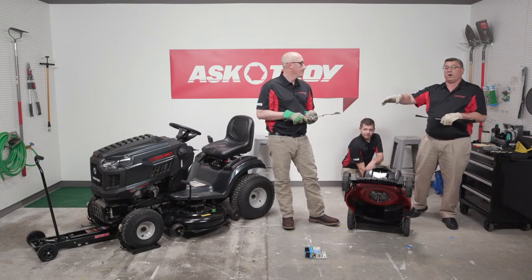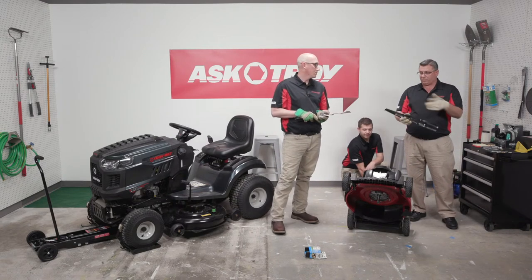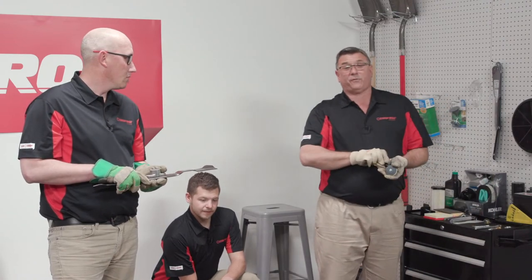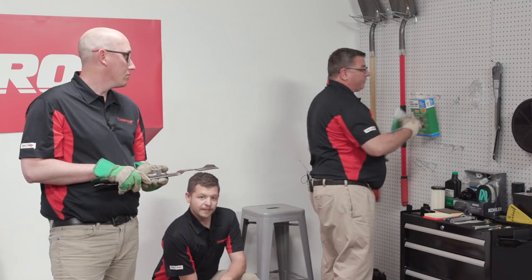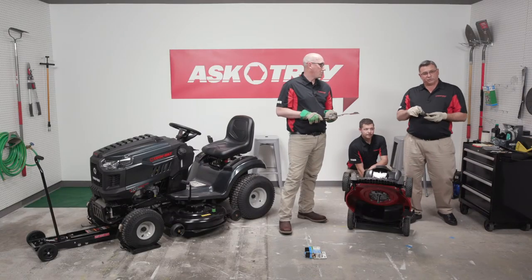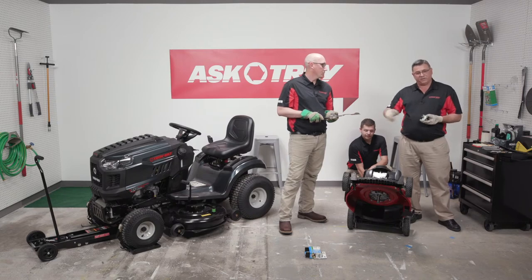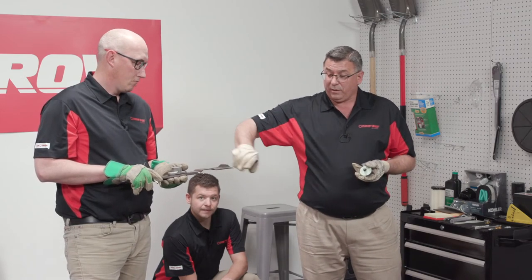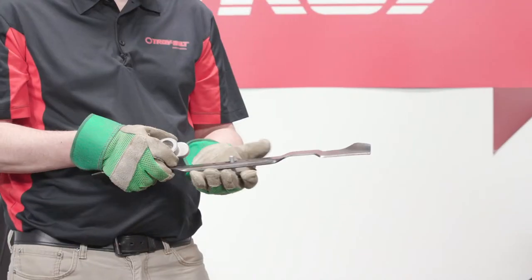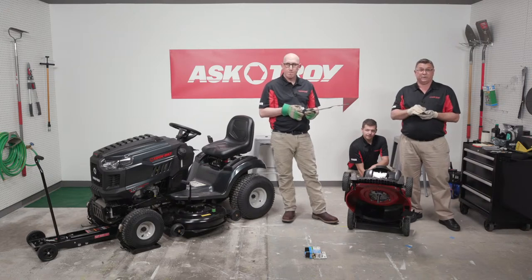You can imagine in your yard you might hit a stake or an anthill. Once the blade is off, you can either replace it or sharpen it. For sharpening, you use a hone kit — a hone that attaches to a drill. Lock the blade in a vise and follow the same blade angle across. When done, clean the back edge to remove any burring. Then use a blade balancer — set the blade on it and ensure it's level. If it's heavier on one side, remove a bit more material from that side.